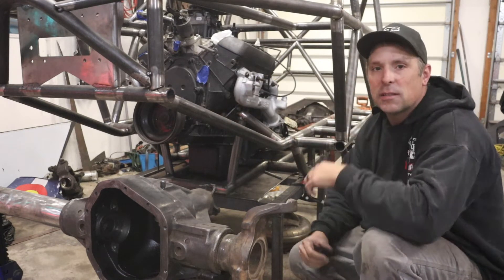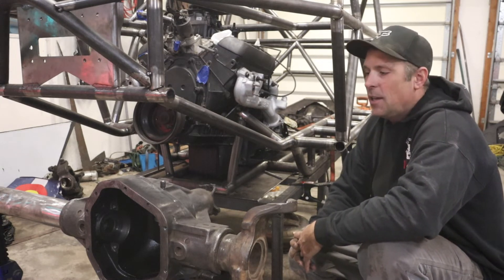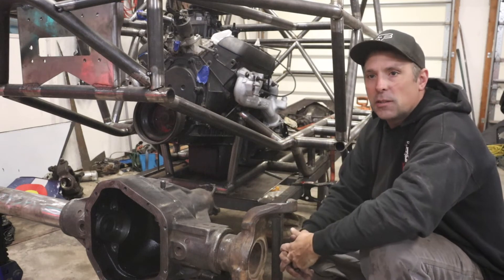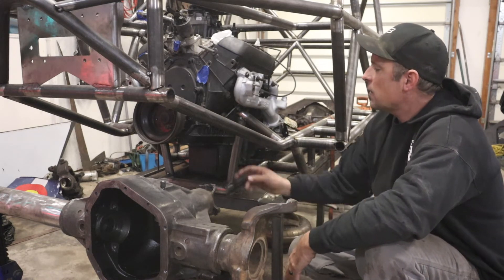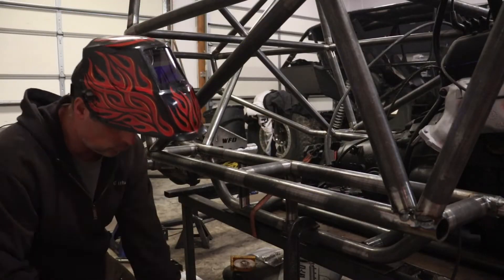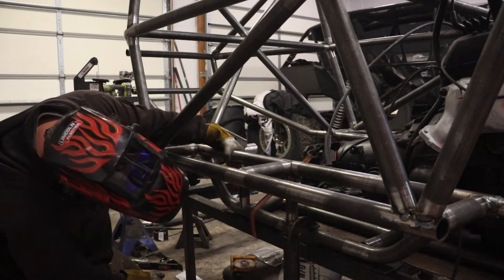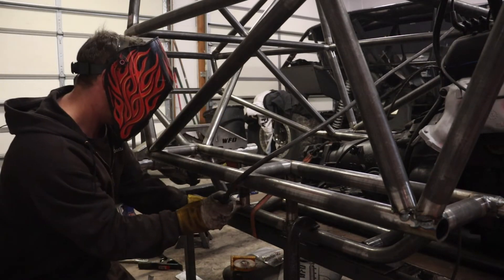That's why my thought was behind taking these up like that — I just wanted to give myself room for the driveline and for the link mounts. If anybody's wondering why I'm hard mounting the motor in this entire chassis: I made a video last summer called 'I Cracked My TH400' — with the rubber bushings and some movement in the drivetrain, taking a hard hit cracked my transmission. Since then I've hard mounted the entire drivetrain and everything's been good, so on this one I'm going straight hard mount and not messing with rubber bushings. I've also been working on filling in some filler and support tubes — I've cut them all to size, notched them, and started dropping them into place to get ready for welding.